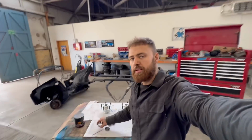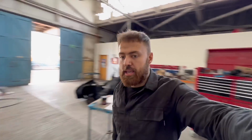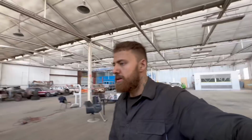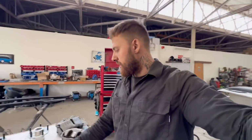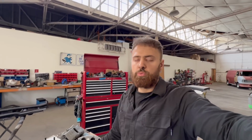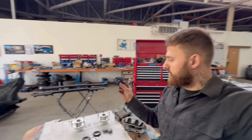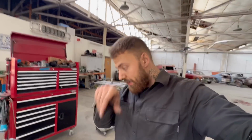So we're up to the VT brake conversion. As you've seen, got these conversion hubs from Castlemaine. I'll put a link. Comes with the bearings. We're going to grease those bearings up, grease in the hubs, grease in the, where are they? Hold on a minute. Grease in the caps. One thing you've got to remember, and don't forget, when you're pulling your old assembly apart, don't throw out these washers that sit on the face, because you're going to need them still. Let's get into it.